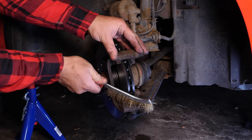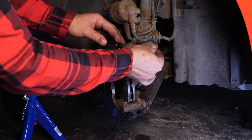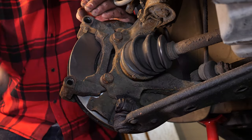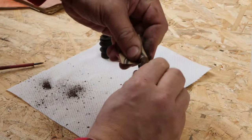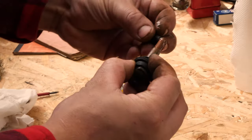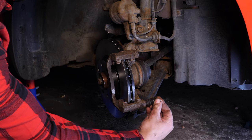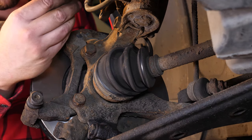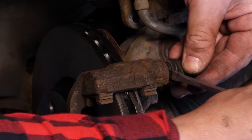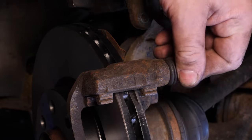Using a wire brush, clean the edges of the brake caliper mount where the pads run. Remove the caliper mounting bolts so that you can correctly clean them before coating the new ones with grease. Also carry out the cleaning of the caliper mounting bolt holes. Depending on the wear and rust of the caliper mounting bolts, it may be a good idea to restore them. We strongly recommend watching the tutorial on how to properly clean the caliper mounting bolts — this will ensure an efficient braking system and less wear on the discs and pads. You can use copper grease or a special grease developed specifically for this purpose. Reassemble the caliper mount, taking care to properly put the protective rubber bellows back on using a flathead screwdriver. Pay careful attention to your movements so as not to damage them.